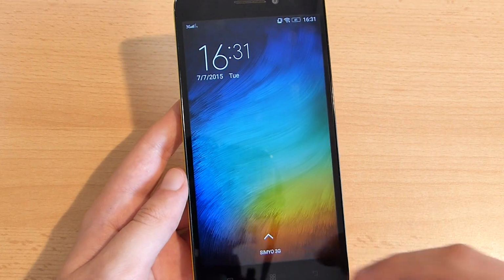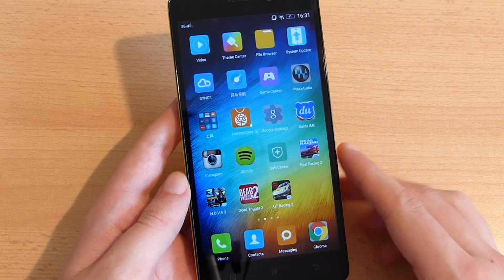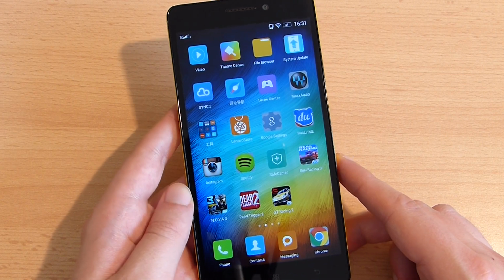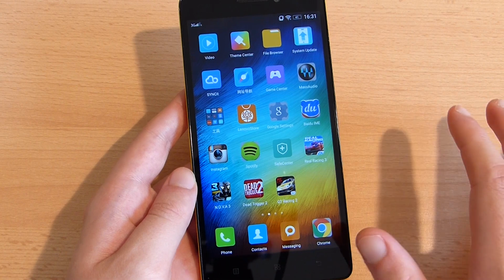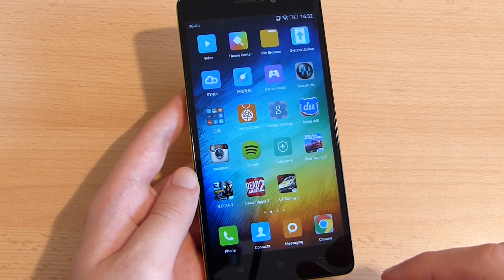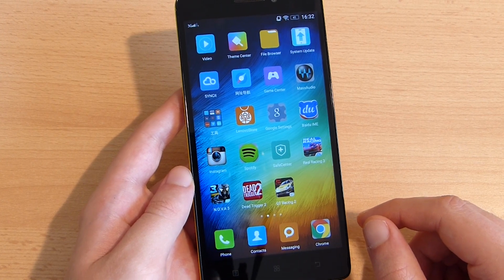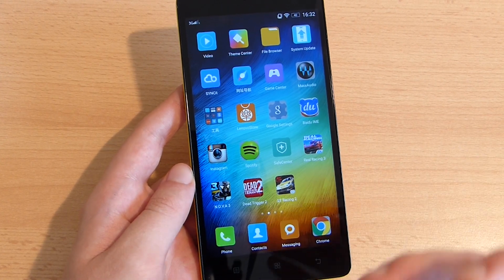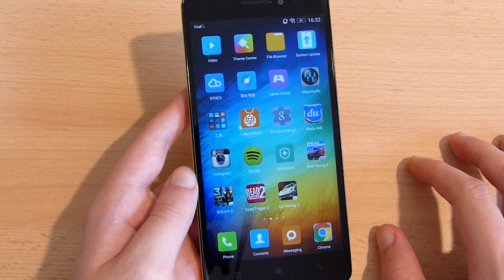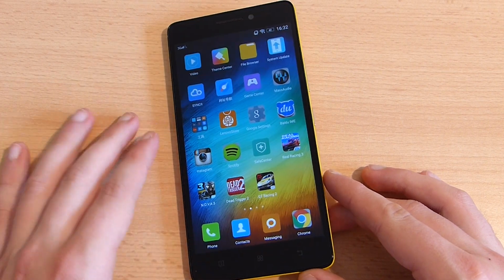And of course, phone quality also includes reception quality. Here I also have nothing to complain about at all. I would say the reception quality is pretty much on high-end level. There isn't really any difference to higher priced phones. And that applies to GSM, 3G and also 4G LTE networks. The only thing I have to complain about is that we don't have FDD LTE band 20 at 800 MHz on here. So those of you using a network provider making use of the 800 MHz band won't be able to use LTE. But that's probably something most people can live with, since LTE isn't that useful right now considering the traffic limitations and all that stuff.